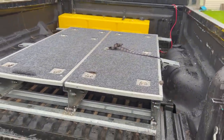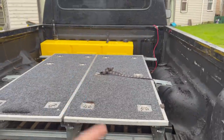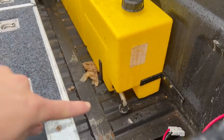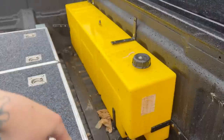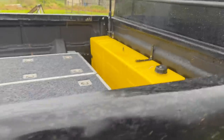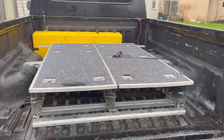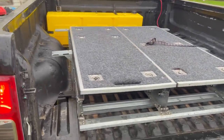This clip is actually after the trip - we've just gotten back from a five or six day high country trip. I've taken the drawers out just to clean everything out, but they worked well. The fuel tank worked really well too - the gravity feed didn't leak at all and gave me another 250 to 300 kilometres. The only thing I'll say is because it's coming out of a 20mm fuel hose it does take a while - if both tanks are dead empty and you start filling this one, it'll probably fill up before it's fully drained into the bottom one. So you have to fill it, let it sit, then fill it again at the servo. But it's still worth it for the price. The tub was super good on the trip too.